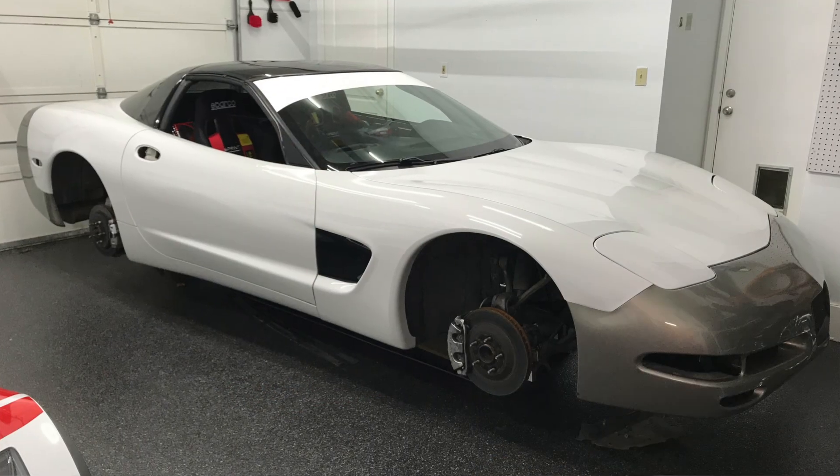You also want to pick a clean environment. If you do your car outside, you're going to get all kinds of debris under it, which is what you're trying to avoid. I used my garage, I put it up on jack stands and left it there because I knew it would minimize the contaminants under the surface. Which means you also want to leave enough time to finish it — it's not something you can knock out in an afternoon unless you're great at it. I decided to do my car through the winter, which means I had as much time as I needed.